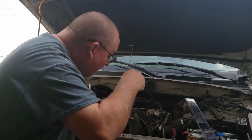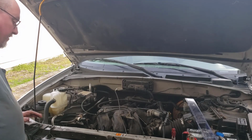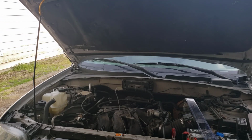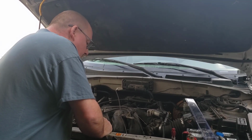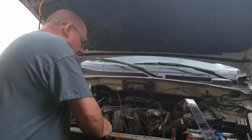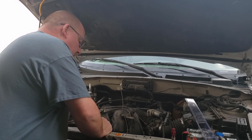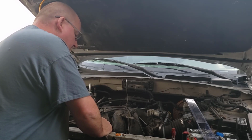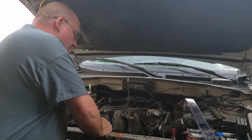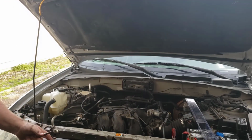I would say, with air, I'm fairly positive that we're very close to it. I'm going to try to roll it a little bit with a wrench. And no, I hadn't moved it. That's just luck right there. I'm moving up. Should be pretty close. Go slow on the turning so you don't loosen anything up. Okay, so this has quit moving. That means that piston is relatively close to top dead center. I don't care what stroke it's on. Like I said, the valves are closed now.